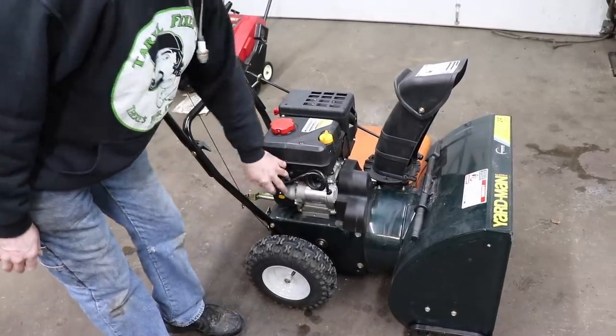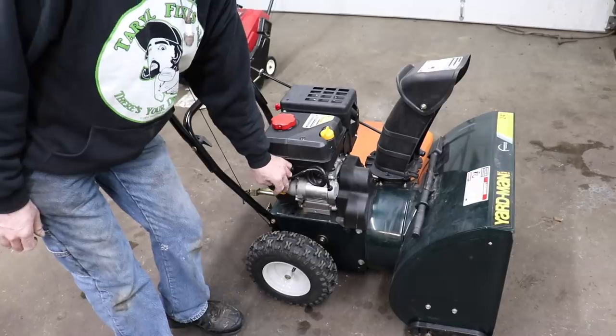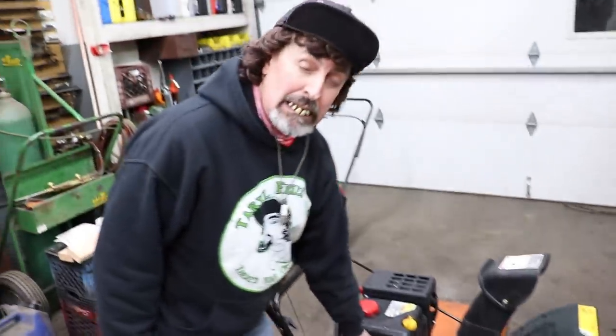So never sit there and crank and crank on the electric starter. You're just gonna burn it out. And that's gonna cost you lots of money.